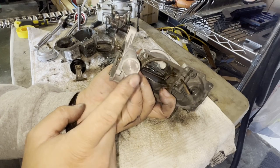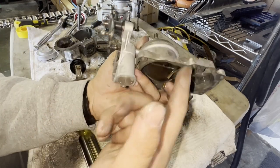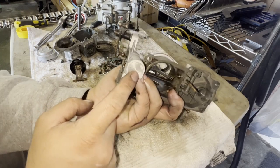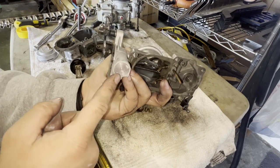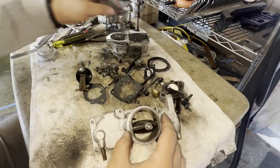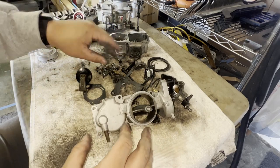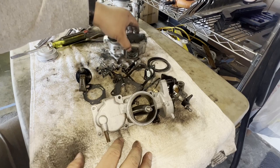So if you have these carburetors, take a look underneath, or maybe you can even just feel underneath without taking out the carburetor. If there's a hole and you don't know where to find the right piece, just use a dime. Otherwise, you can probably find them on Samba — I think these were shipped from somewhere in Belgium. So I think that's everything that needed to get taken apart from this first carburetor. I'm going to spend some time brushing things up and cleaning everything, and then I'm going to throw everything into that ultrasonic cleaner.